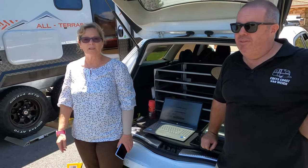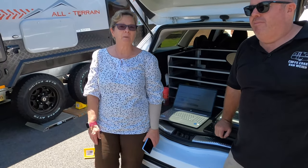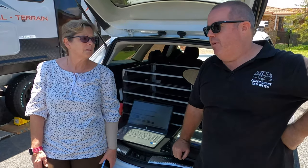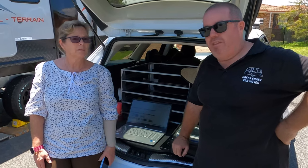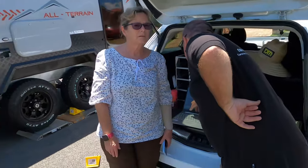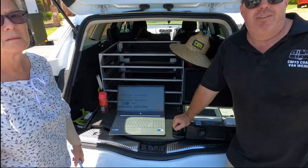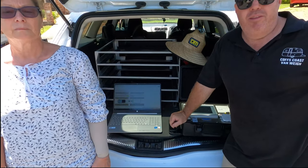Yeah, cool. I think, well, we know what the problem is now. Yeah, I know. On the flip side, I suspected it. The easiest way, and it's not cheap, but just get a GVM upgrade. Get a suspension upgrade. Get a GVM upgrade. That will take that number away. Yeah, right. So GVM upgrades generally give you 10% of the total weight. So you go from 2910 to another 300 kilos that'll give you. Yeah. So basically wipe that problem off to zero.